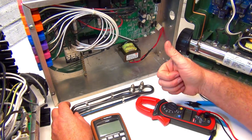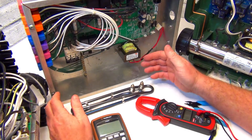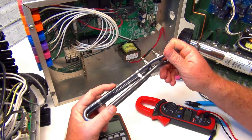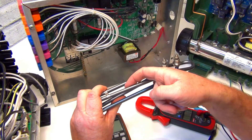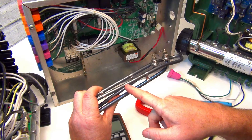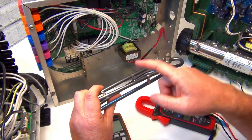The three ways are voltage, amps, and continuity. Continuity just checks if there's a flow right through, but a lot of times you could still have a pinhole in the element and still not heat, but you'll have continuity. You might not have any amps through it but you can have continuity because the steel is still connected.